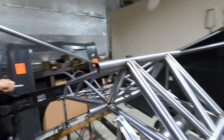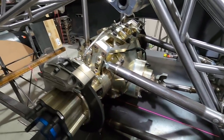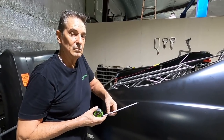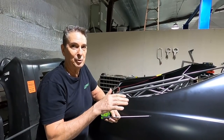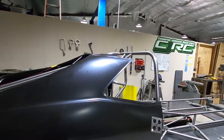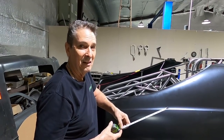These little tubes here just hold the quarter panel — nothing structural. We have Infinity brackets from B&B that we use on this car; they allow adjustment in eighth-inch increments. The string is Danny's — he measures everything off it; that's dead center of the table and his go-to reference. You need a point you can measure everything from, because once you put something in that's not straight, the rest of the car will be a nightmare. Every time you measure off that string, make sure nothing is laying on it pushing it off to one side.